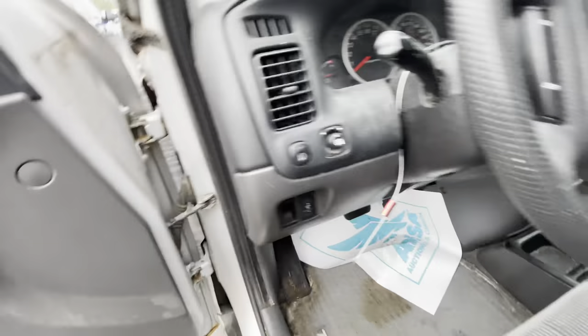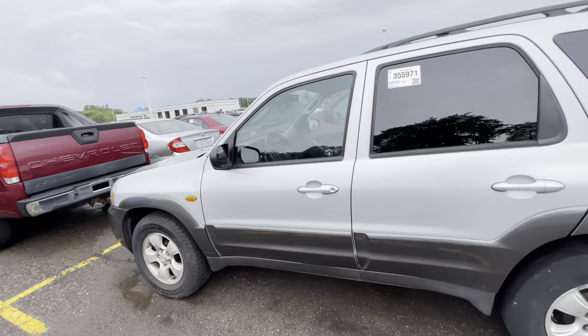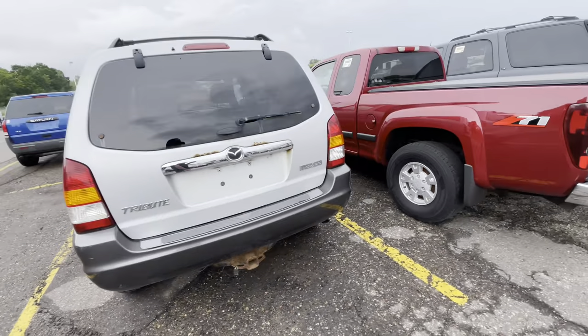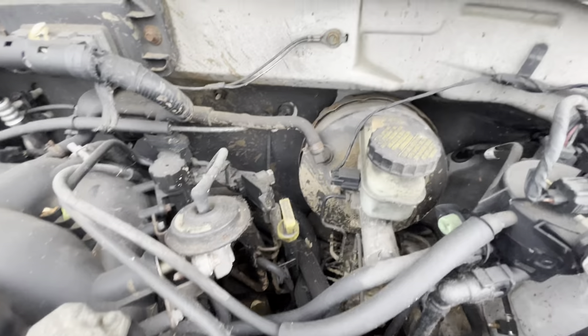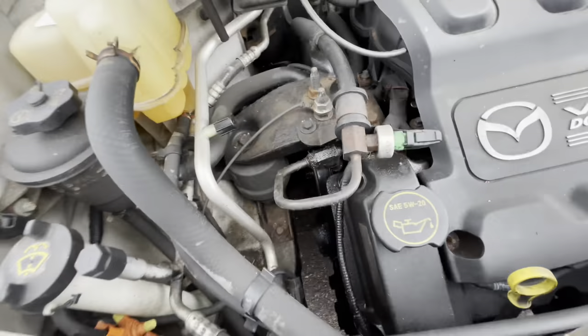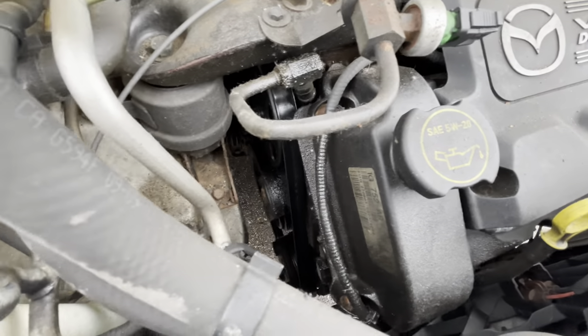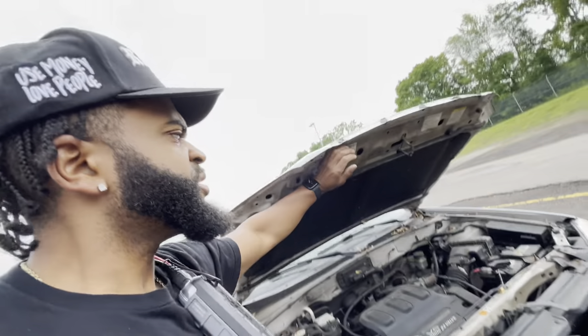It's a little dusty in here, doesn't smell terrible, but you can tell this thing is like a farm car or something. This thing needs a jump — I'll have to come back on this one. Let me just look at it real quick. I don't mind getting any of these smaller SUVs right now because they got the V6 motor. The coolant is a little low — nothing terrible. It's got a little sign of leakage over there, might be just that valve cover. We'll come back to this one.